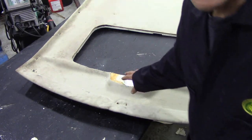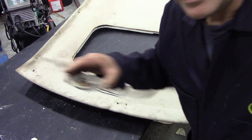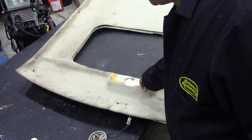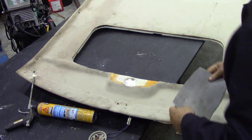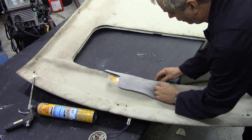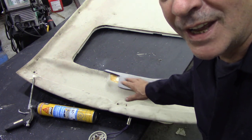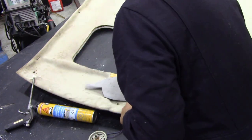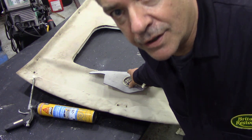This panel here was a plastic panel that had the sunroof operation and the light in it. What I did was bond a piece of aluminium to the underside of the sunroof, sprayed it, filled it full of spray foam, and then when we cover this — now this is a test piece of material — we cover this with this. You can see you hide all that, and your corners are going to come really, really nice. Don't be put off by what it looks like now, because once we get this on, it's going to look superb — the backing foam takes off a lot of discrepancies.